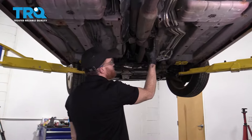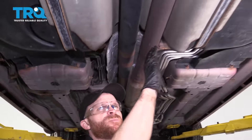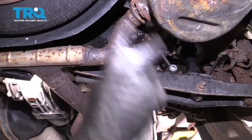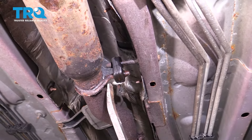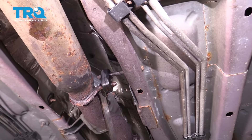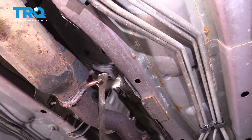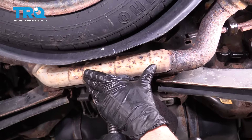To lower the exhaust, you'll find a rubber grommet mounting point that we need to disconnect. Follow the pipe back to both mufflers — you'll find three more mounting points on each muffler: one here and two more along the rearward aspect. Starting with the forward mounting point, use a pry bar to carefully get in between and gently pry it out of the mount. Inspect the rubber mount to make sure it's still in good condition, then make your way to the rear mufflers. Put something underneath the exhaust to hold it up while you continue.